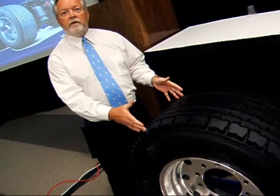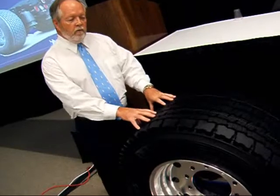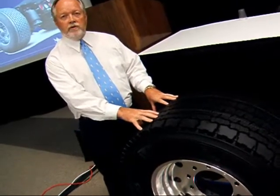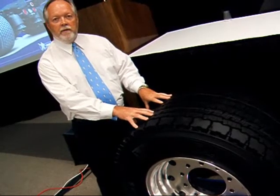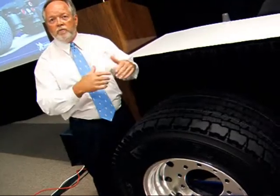The second major area of effect in the tread area is the tread design. The idea is to create good wear and good traction, but without unnecessary movement. In doing this, we have created matrix siping. Siping presents an edge to the road as it rotates down. We have zigzag features sideways and up and down inside the sipe that lock it in place, therefore making it act like a block but perform like a sipe.